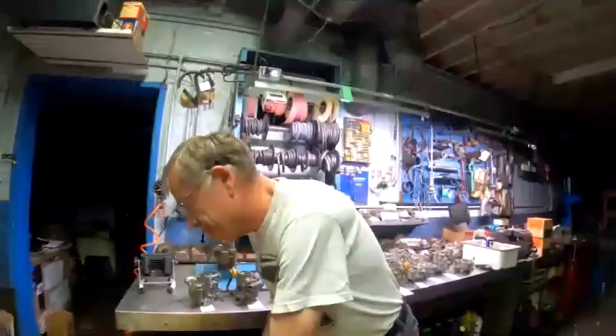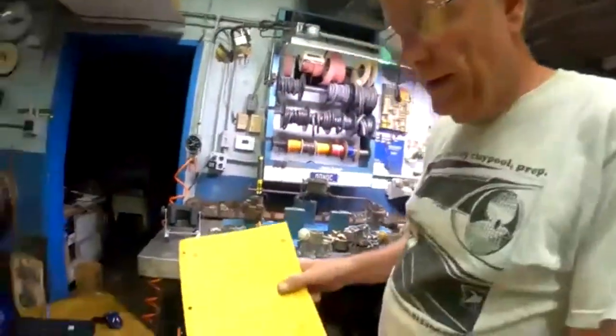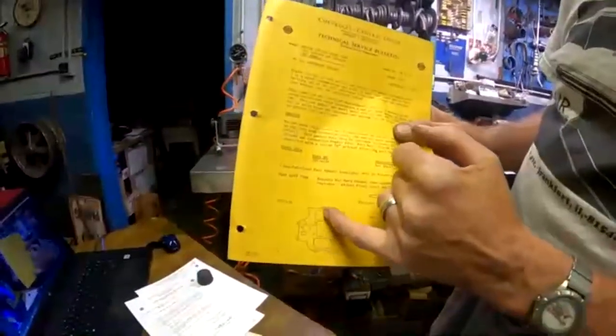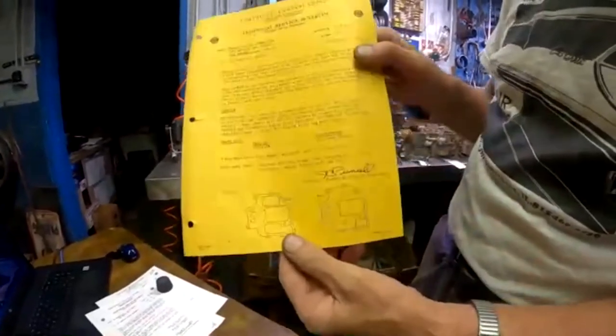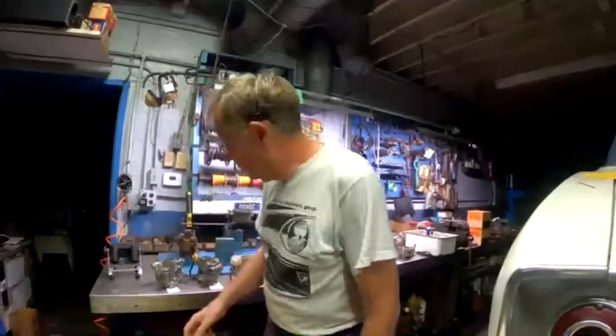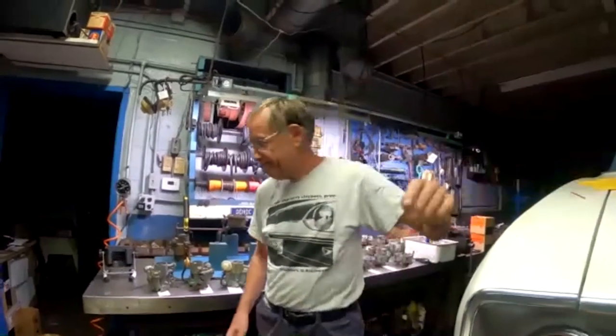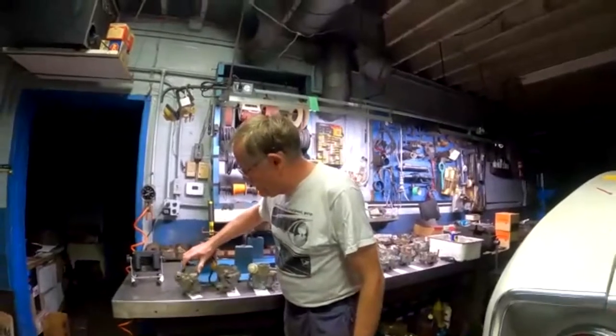So then, yet another bulletin in August of '61, they changed the gasket on the air horn. The old ones were open above the floats. The new ones had the two little holes that you're probably familiar with from your rebuilding kit. What they were finding is that Corvair models with 3 or 4 speed transmissions may have a cutout on hard right-hand corners due to fuel spilling out of the bowl and going up in the vent. So apparently Corvair drivers were starting to have fun with their Corvairs and go zooming around some corners, causing some flooding problems. So a new gasket style in the carburetors came out. Other than that, the '61s are, again, pretty simple.